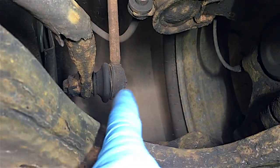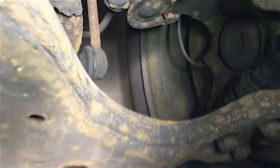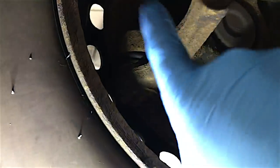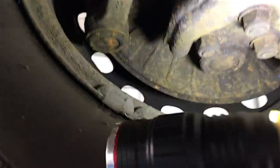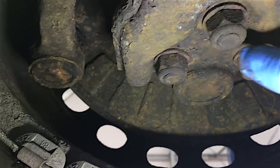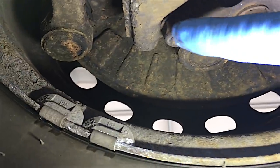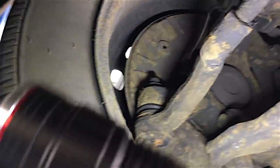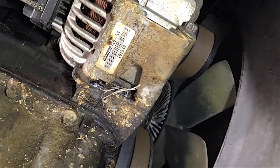Carry on. I'll try to remember what I've actually done to this van over the years. Anti-roll bar drop links I've replaced about three or four times, but I've been putting cheap ones on so they don't last. I've replaced all four coil springs - they were all broken, but you can expect that on any car. I've replaced both track rod ends and both bottom ball joints. The original ball joints come with rivets which are a pig to drill out - you need an air chisel. There's a very clean-looking alternator up there that I've replaced - that alternator done well.